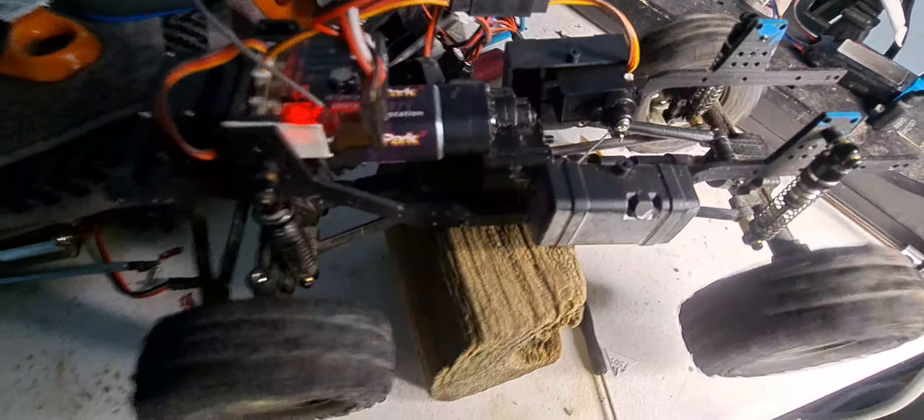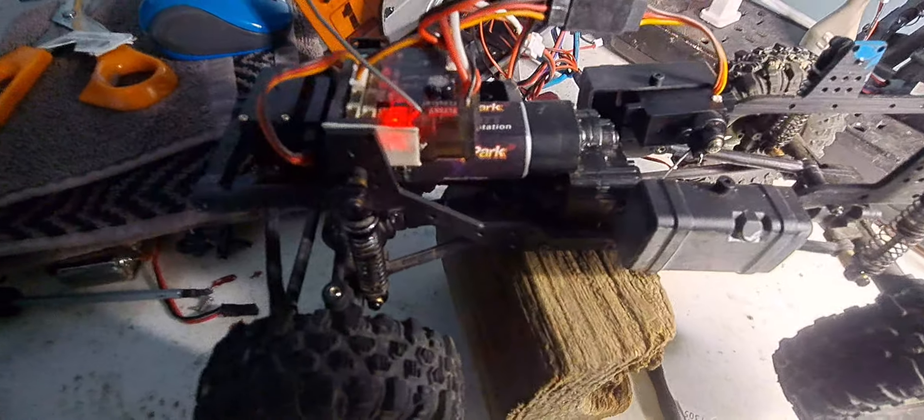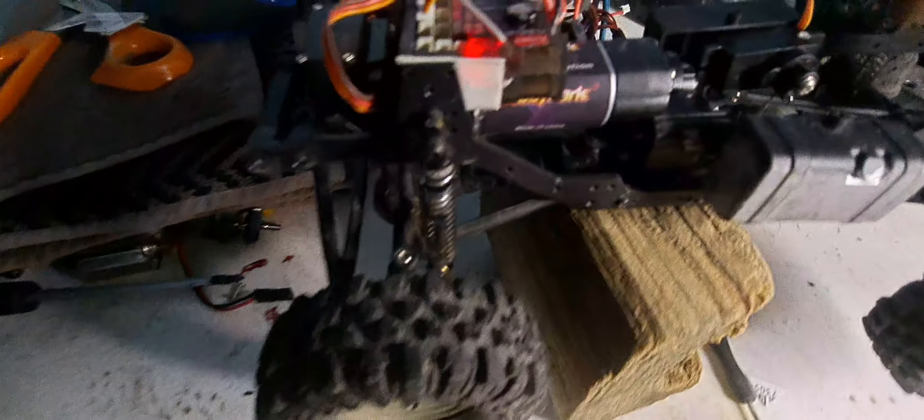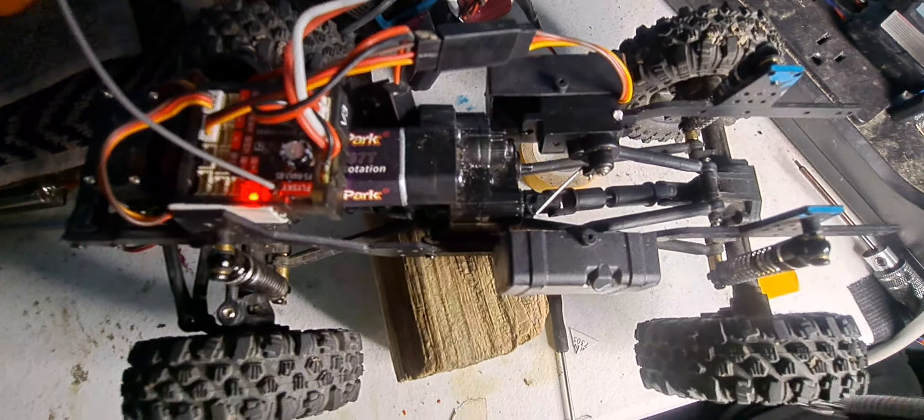So that way guys, you've got your servo mounted inside the box — you don't have to worry. You can see that it's shifting flawlessly. That's all it took. I got really frustrated because I had already spent like two hours trying to figure out how to get that little wire, because the servo was originally attached to the roll cage and I was having problems trying to get that thing in the hole. So I figured out another way and came up with that mount right there. I'm sure this will help some of you guys — some of you have probably already figured this out, but that's what I came up with. It works great, I'm very happy that I did it.